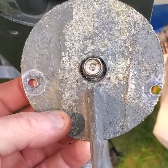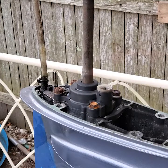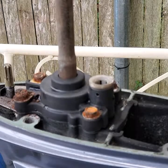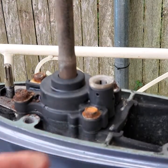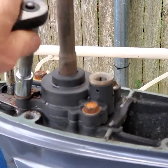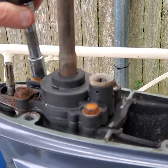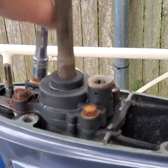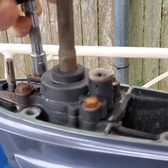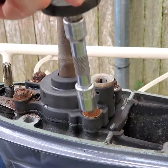Your cavitation plate has that anode, and they've drilled through the anode to put the fins on — that's a first, I've never seen anybody do that. You've got to take that off first. And then underneath that there's a bolt up here, which I've already taken out. So here we are — I've got the lower unit off. There is a spline shaft, so there's nothing to disconnect like some engines. I always like to try to take the bolts off first. It does take a 12-millimeter socket.